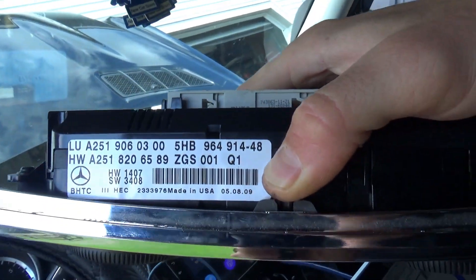With the AC compressor plugged in, I tried the replacement junkyard controller — it's actually three years older, timestamped 05/08/09. This one couldn't even turn on a 500-milliamp light bulb. The original controller has no problem with that; it handles up to 800 milliamps. At one amp it says too much current.